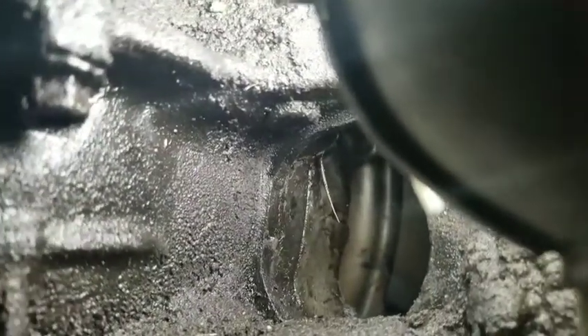The other place is if you remove this rubber cover way up — if you go up the transmission, below the pan on the engine, and remove that plug from right there. I find those are a little harder to get to because you can't get your head up in there to see. There's your access hole right there so you can see the back of the flex plate. Just thought I'd show you those two ways.